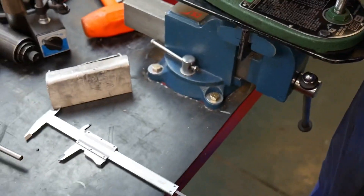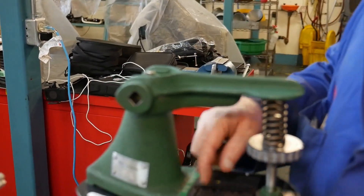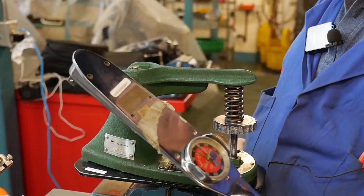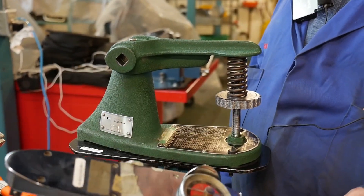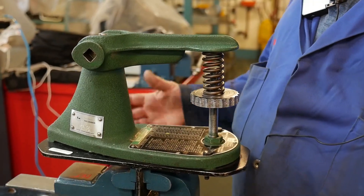If I read the directions, it says you take the torque that you get on your dial torque wrench and you double it for the spring force. So at 35 foot-pounds, that means at that height, that spring has 70 pounds of force to compress it to the closed valve height. And if that is within spec according to our manual, then that spring is reusable.